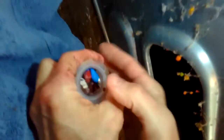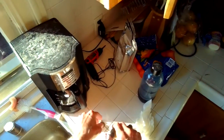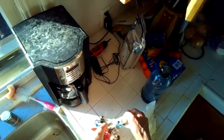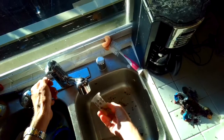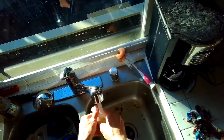Once you get it back, you can find some stuff caught in there. You can pull out this plastic thing that grabs hold of coins and debris. This is probably about 10 years worth of stuff collected in here, so I'm going to empty it out, rinse it and wash it, then install it back in the washing machine. That's why it wasn't draining — this thing was full of junk accumulated over the years, draining slower and slower to a point where it finally didn't drain at all.